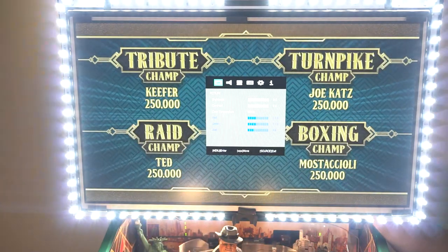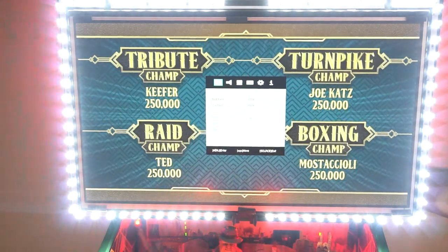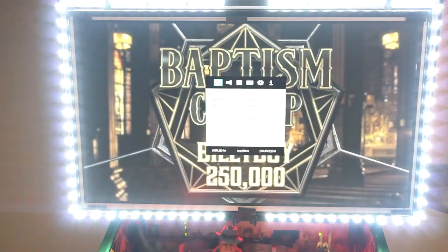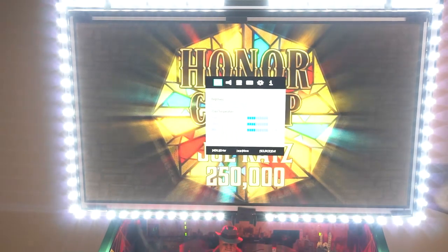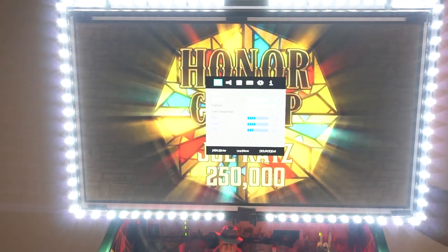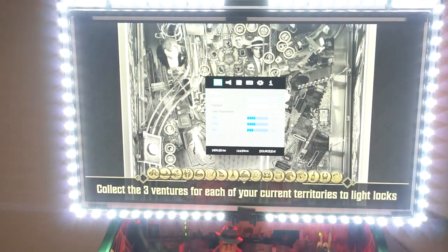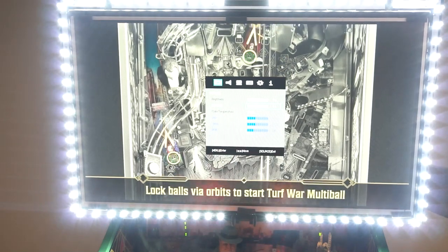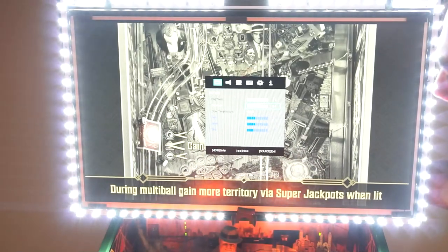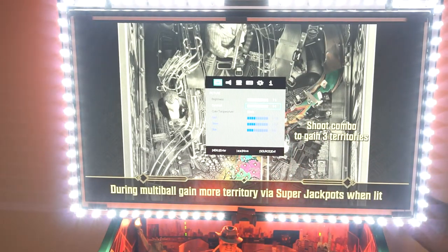On the rear right it does say menu. You have the option for brightness, contrast, and color temp. Somebody posted some numbers you might want to use. Stock color temp is 6,500. I tried 93 — got a little darker. You can actually set this to 'user' and play around with the reds and greens. I'm going to leave it at 65. I was going to bring down the brightness and raise up the contrast. You could always look at Pinside to see what others have done.